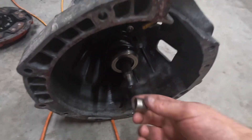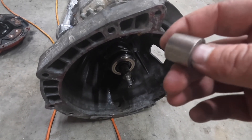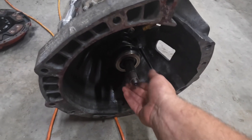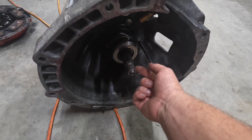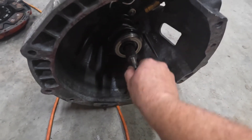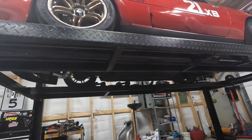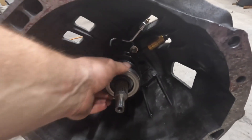Here is the new bronze bushing. I've been fighting getting the old pilot bearing out — finally got it out and started cleaning up. The only dimension that's slightly different is it's slightly longer overall by about 0.2 millimeters, which really isn't much and there's plenty of room inside the crank. I put one in my spare crank at home and the way it spins on the trans input shaft seems pretty good. When I had the bearing in the crank I tried spinning it by hand — it didn't seem rough at all. I'm starting to think it was a bleeding issue. I'm going to try getting a speed bleeder and maybe ask Leslie if they have a power bleeder.